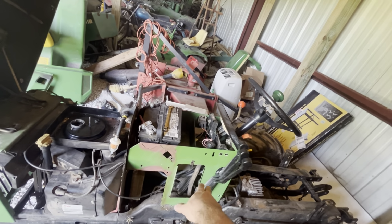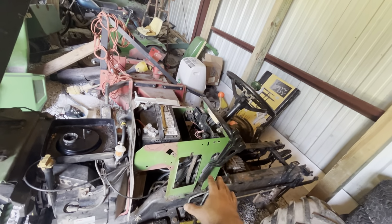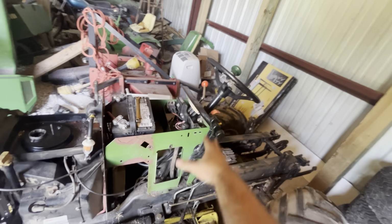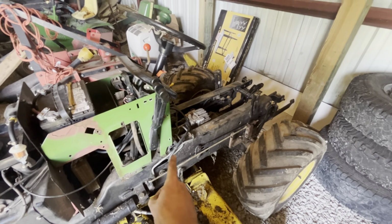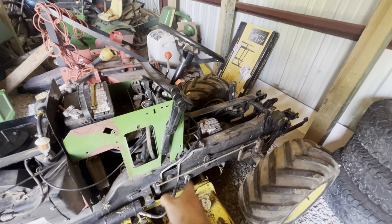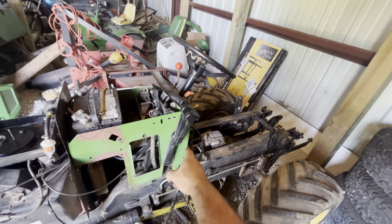I took the selector valve out and cleaned off the nipples because there was a bunch of dried rubber on there. So I cleaned that out, put it back in the panel. Hook them up. So right side one there is my main pickup, which it's like that on the tank. It corresponds. Right side's main fuel pickup, left side is your reserve.